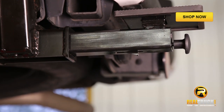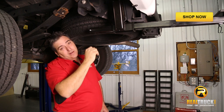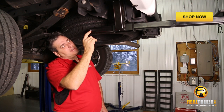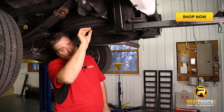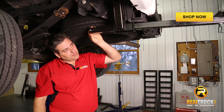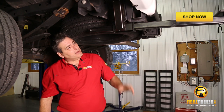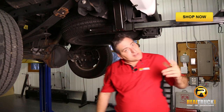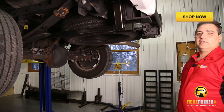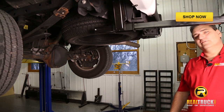One thing to keep in mind: when you put this bolt and nut back on, this is a self-locking nut. Even if you don't get it all the way tight, it's not going to fall off. You just want to snug this down so that the end of the bolt is just at the edge of the nut, making sure it gets through the locking part. If you get it too tight, your spring in here is going to get messed up and it's not going to work your release. There's no need to work the release to close it — you just slide it closed. To open it, lift up on it, pull down a little bit, and out she slides.